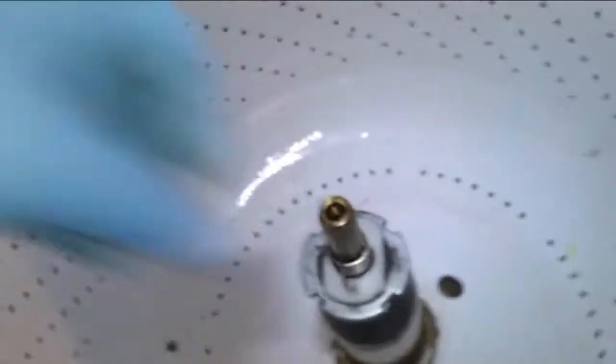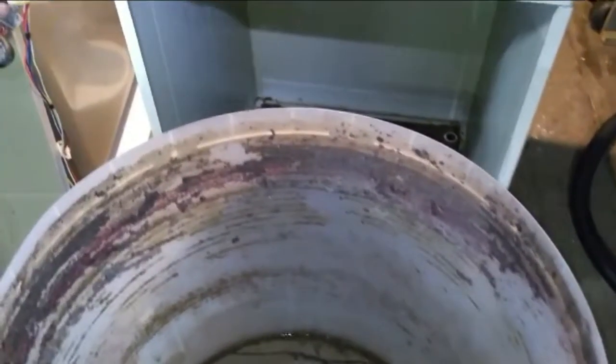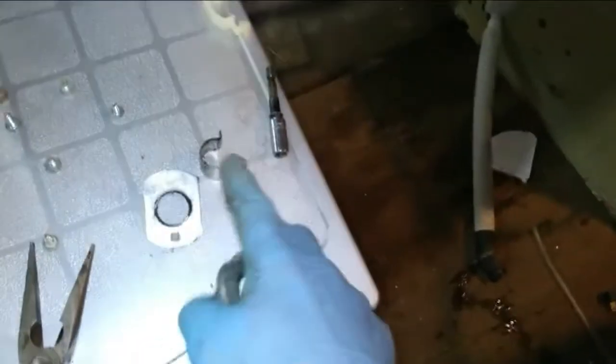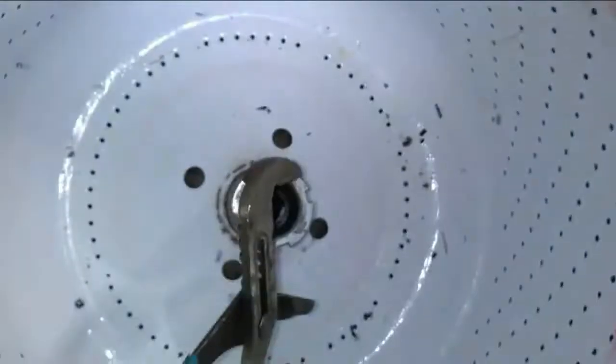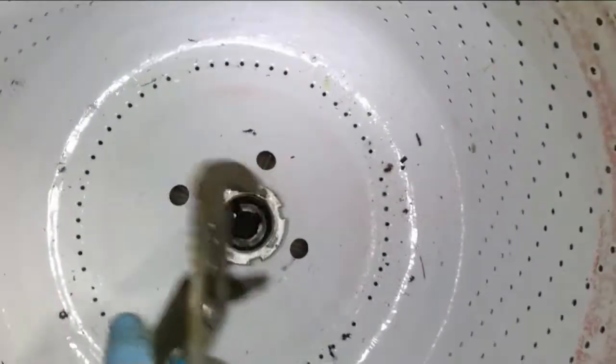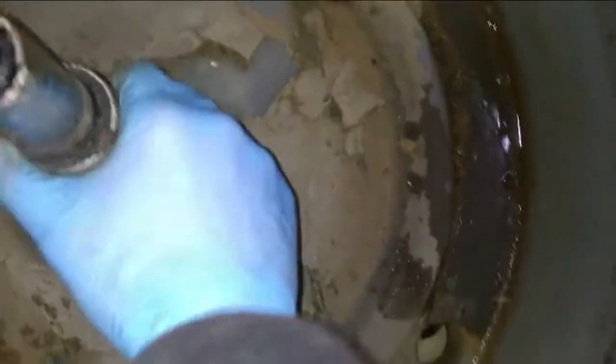Get this pump out - I think it'll come up once I get the thing out. I've got to pull the clip on the shaft and all kinds of stuff. I need a laundry machine. To remove the barrel, take this clip off the center shaft - the drum will be in there screwed on tight. Take a hammer and some channel locks, grip them on the nut, and hammer the corner while turning to knock it loose and spin it off.